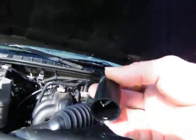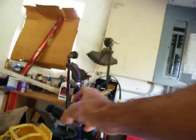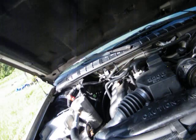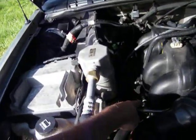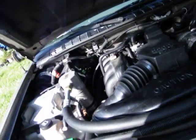This is just actually what needs to be changed. Here's what it originally looks like, but that's the old one. I've got to put the old one back in there and test it and see if I've got oil pressure, because when I got to fooling with it and just undid the wire, that thing just slid right off, so that was a problem. That means I've got to take all this off to get down into there, and I'll probably have to pull that alternator out just to get to that sensor.